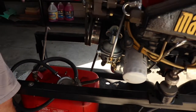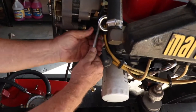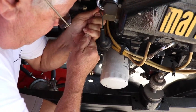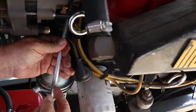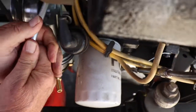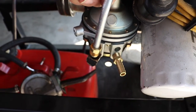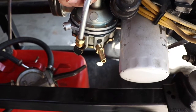So what you can do is just grab this fuel line — everything's tight at the carburetor — and then you can just grab this fuel line and gently massage it down and you can bend it. You can see we're almost there. So now we just have to pull this out a little bit and bring it down a little bit. As you work it, we start getting closer and closer, and you just keep working it until you can get this started into the fitting, and once you do, you just tighten it up.